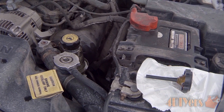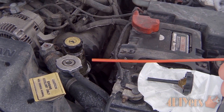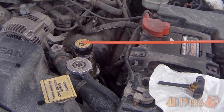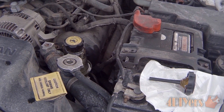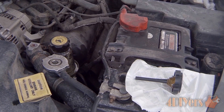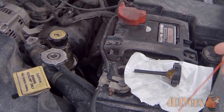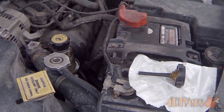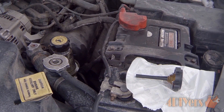What can happen over time is, if you run your truck from day to day, we do have a vent located on this power steering reservoir cap. Over time these vents can get plugged up with oil residue, and dirt gets prominent in the system, or they just completely fail altogether where the spring gets plugged up and doesn't allow the excessive pressure to be released in the tank.